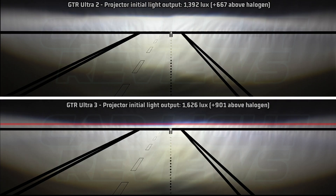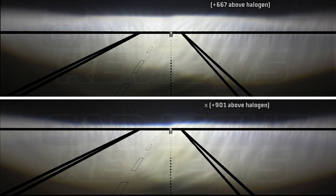Brightness is only half the story. Take a look at the cutoff line clarity and location — this is where the Ultra 3 just pulls away. The Ultra 2 had an excellent cutoff when it came out: bright, sharp, and better controlled than most LEDs of its time. But the Ultra 3 is on another level. The hot spot sticks exactly where it should, and the cutoff hugs that hot spot tighter than anything else I've tested. Razor sharp, clean, no scatter, and the overall beam is very full. The Ultra 3 has the best projector cutoff I've ever tested in terms of clarity and position — and accuracy like this is one of the biggest, most important factors in a headlight upgrade, arguably more important than raw brightness numbers.